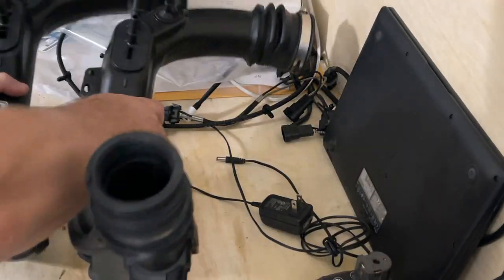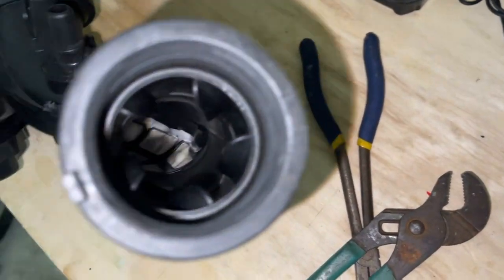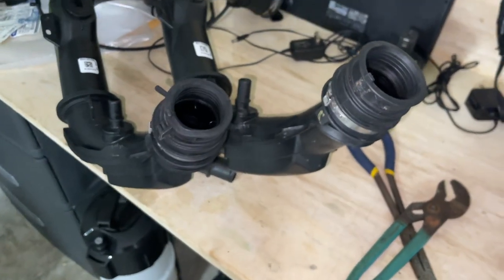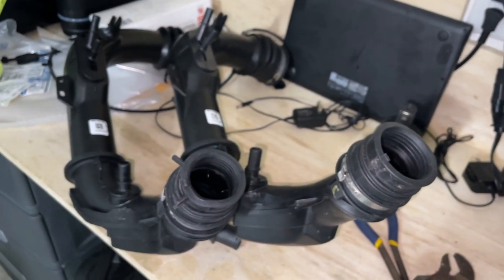Let me turn the light on to show the inside of the pipe. This is the 2022 — the one that came off my car — and the pipe is clean and smooth on the inside. The one for the 2020 and early 2021 that has the blow-off valve has a mesh screen inside the pipe. Also the fin design on the 2022 seems to be a little smaller with more turning. Just a couple small differences Ford made.